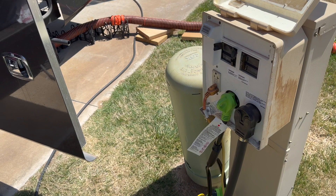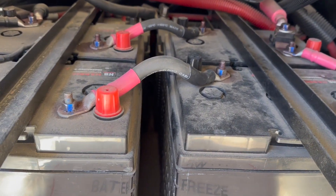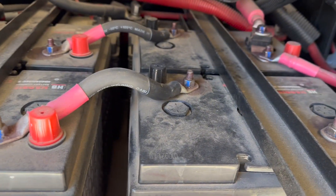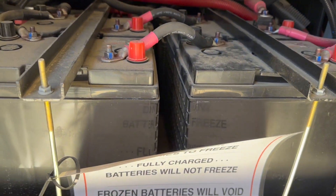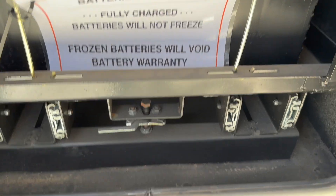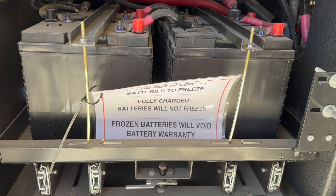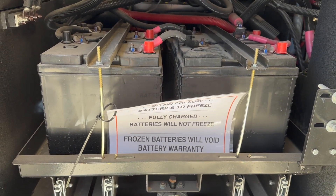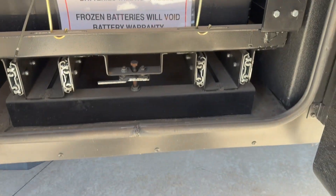The main use case for AGS is if you have pets in your RV with the air conditioner running on a hot day while you're away — you'd want the generator backing up the shore power in case of a power outage so your pet doesn't overheat. Another piece of the electrical puzzle is the batteries. There are four house batteries up front, and behind those there are two chassis batteries for starting the engine and running the truck. There's a cool feature where you can push a button on the console to jump the truck batteries with the house batteries. There's also a lever to pull the battery tray out for access, since they're maintenance free but good to be able to swap out.